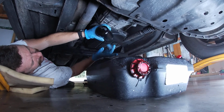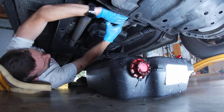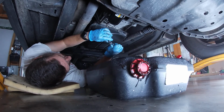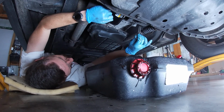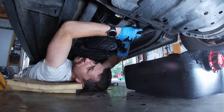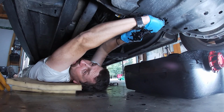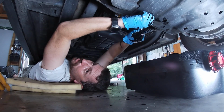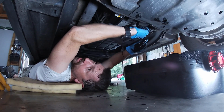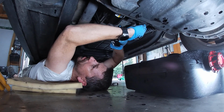Got the mileage on there. Here we go. I didn't have the half-inch drive, so I'm doing it with a half-inch wrench. It's the worst part, getting it started. As I'm going, I like to back off and clean the threads a little bit. Even with the tiniest taps, I've never broke one. Why did I say that? I haven't broke a tap because I feel like I just add some pressure and then back it off. Once I know it started, I can feel it kind of cutting, still going through.